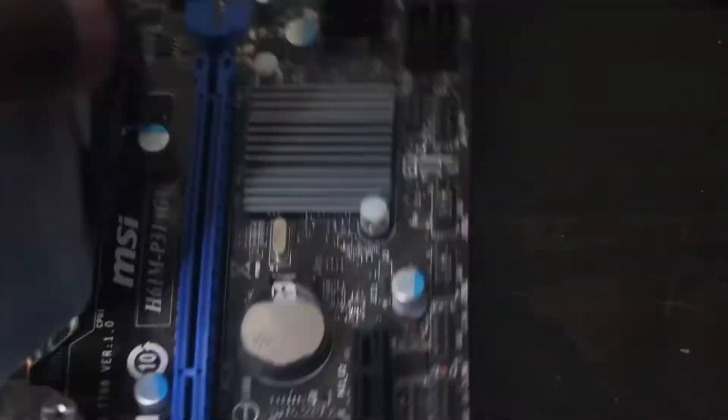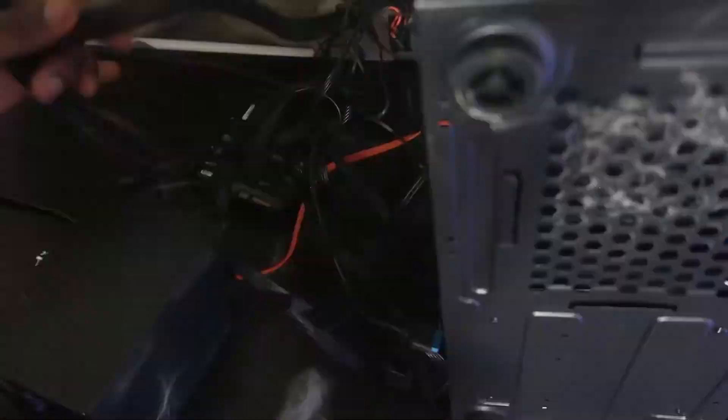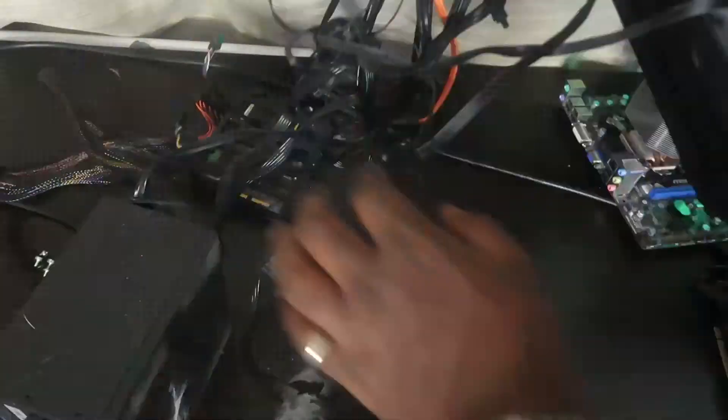I'm gonna turn the motherboard so you guys can see when it turns on. It's gonna put the panel in a bit of an awkward position but I'll still try to get it in for you. So here at the JFP1 panel, I'm gonna go ahead and touch it right there — and you can see the light turn on and the fan starts. If a graphics card was connected via HDMI, you could plug in a USB keyboard or mouse and potentially even play your gaming PC for about an hour outside of the case to make sure it doesn't overheat or anything goes wrong.